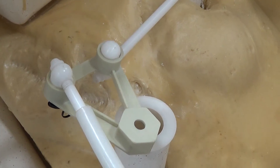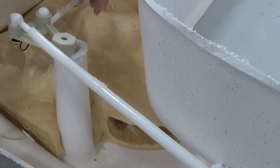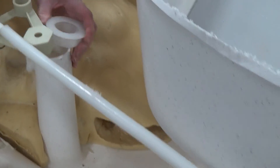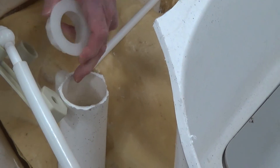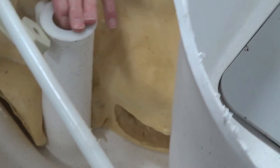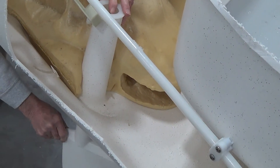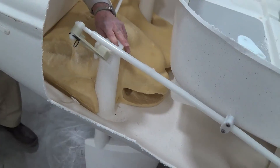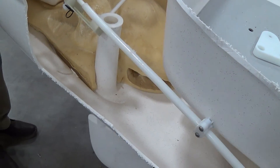So we're going to go ahead and do that. I'm going to put the rudder back up through, and you have to be very careful. This bushing here does not get knocked up out of the rudder tower and down into the boat. So when you put the rudder back up through, make sure that bushing is in place with your hand. It's helpful if you have another person help you put the rudder up through.